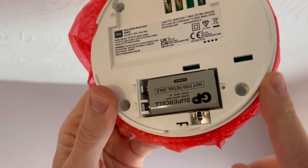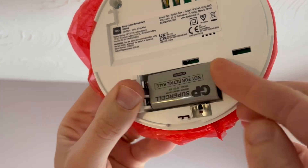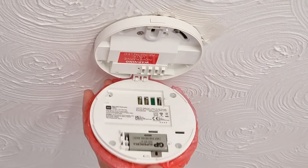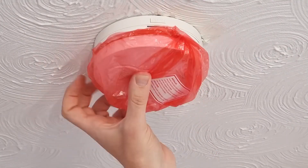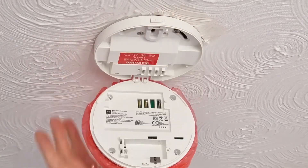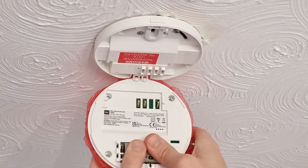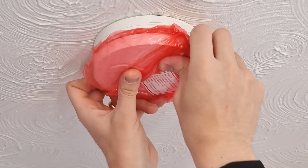One clever feature of this battery terminal is this little sprung clip on the side here. You can see that when the battery is removed it shifts out and there's a corresponding pin on the base that lines up with the clip only when the battery is in place. So if someone comes along and removes the battery to use in their remote control, the lid of the smoke alarm can't be put back up and it'll just stay hanging down displaying a very clear warning sign on the base until the battery is replaced. You may not be able to fix stupid but at least you can offer a warning.